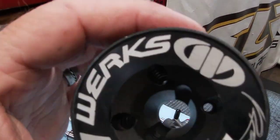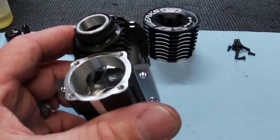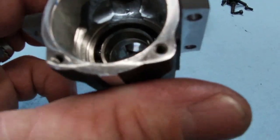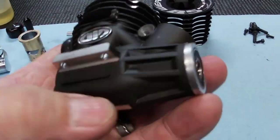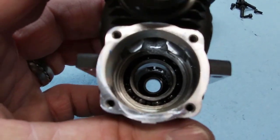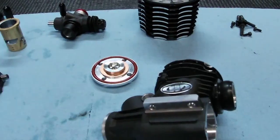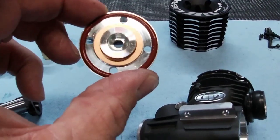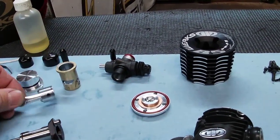These are all the looks, but more importantly you want this thing to perform. This is a bottom-end engine, a stump puller as they call it. It has Swiss-made ceramic rear bearings — I'm assuming just a regular steel front bearing. Silicone-filled crank, gasketed head button — this is a badass engine for under $300.